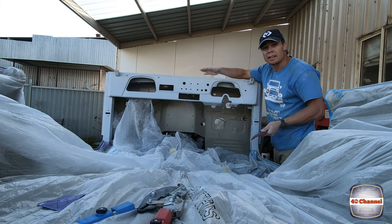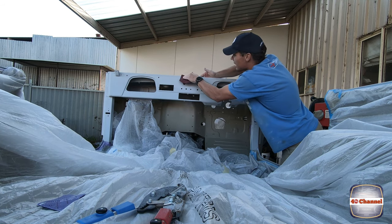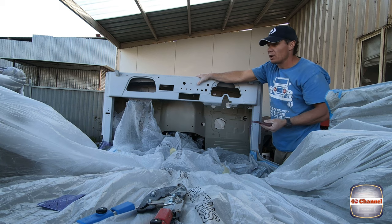Now sanded 120 and then 180. I'm just gonna go over the whole thing again with a scour pad, just to give it a last bit of a clean. It gives it a bit of a smoother finish. That was a suggestion that was made to me. And then we'll throw on the acrylic primer.